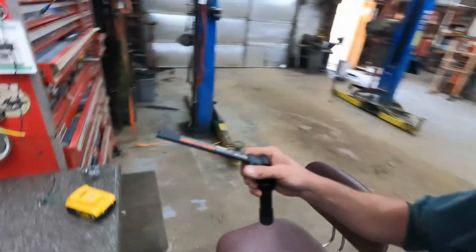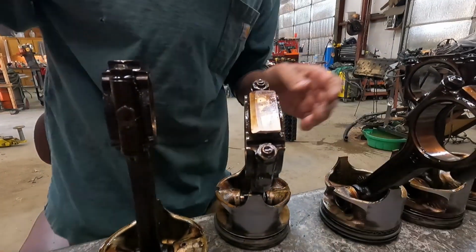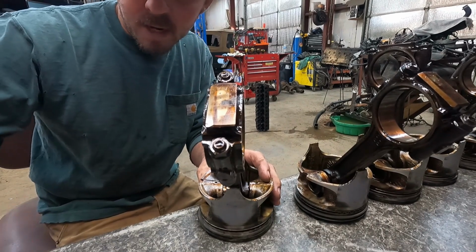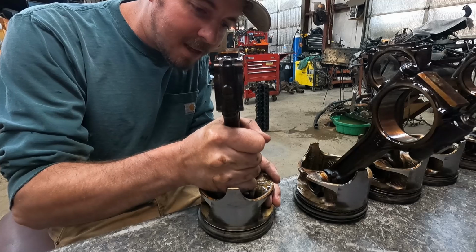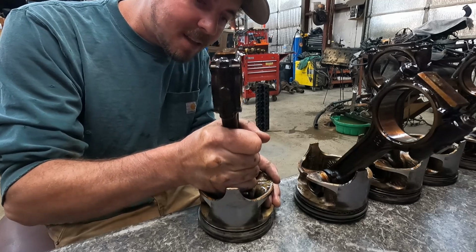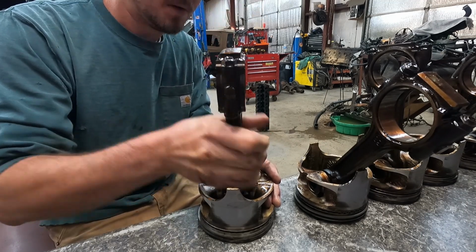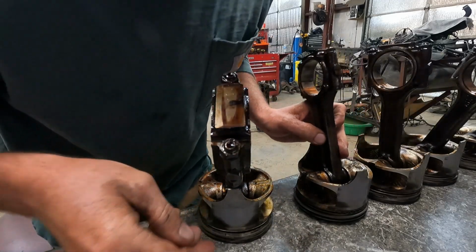So this is what I hope I'm able to show you. I'm gonna lay the camera down. I'm gonna be real quiet if this will lay down. I think I got a wrist pin issue. If you can hear that, that's it going up and down. So that means there's slack between the oil. I'm gonna run over there and ask Justin about it, because I'm not a motor expert.